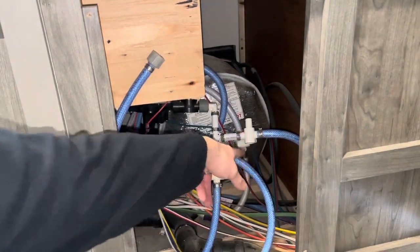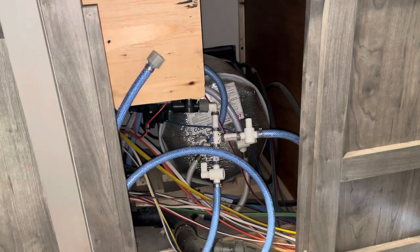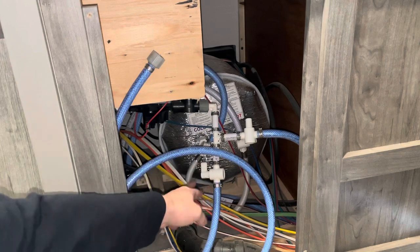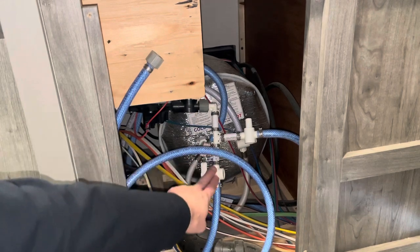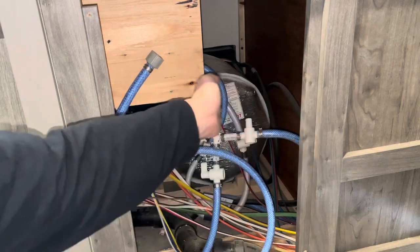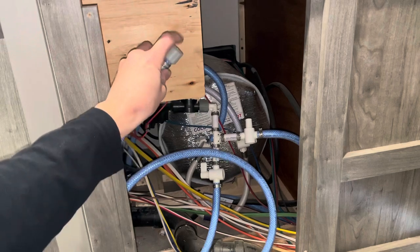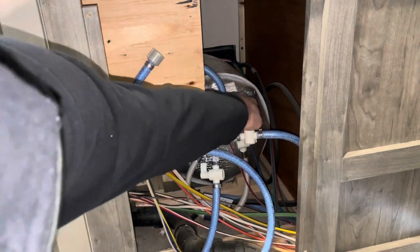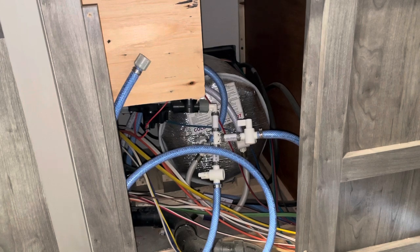We weren't going to talk about these valves right now, but here's my water pump line coming down. Depending on your floor plan, it may be laid out slightly differently — this one is nice because it's all in one location. Let's talk about what a ball valve is. See the direction of the handle — that's the direction the valve is open inside. This one is allowing flow, which is because the unit was just winterized. The other one is pointed the opposite way, preventing flow — stopping it from pulling from the fresh water tank and allowing it to draw from the quick-winterization hose instead. We're going to reverse that now, because we may go dry camping and will need that fresh water tank.